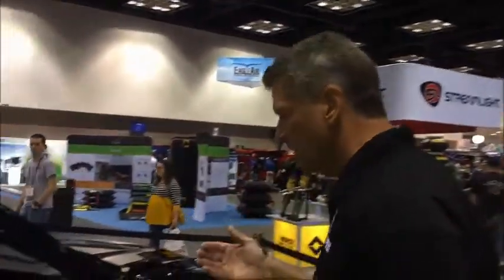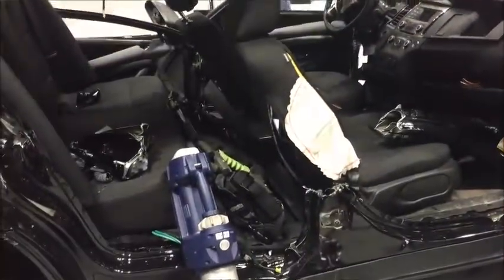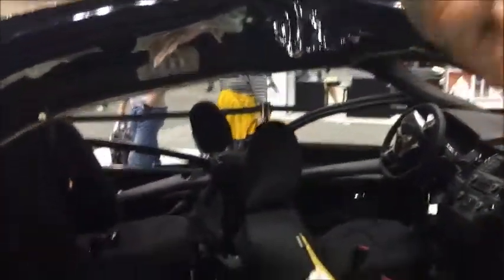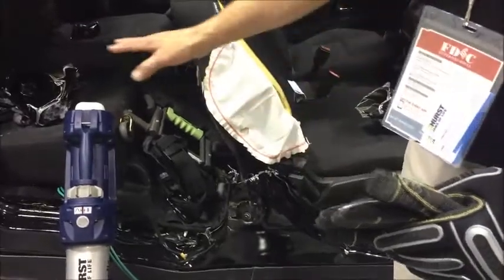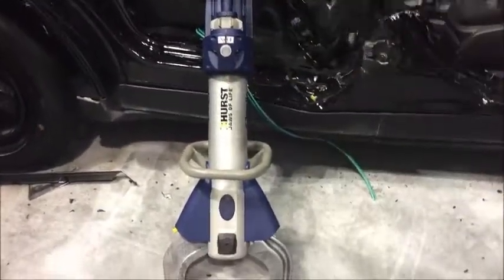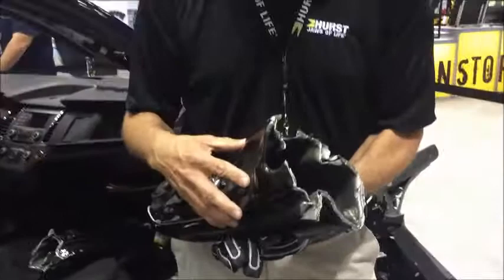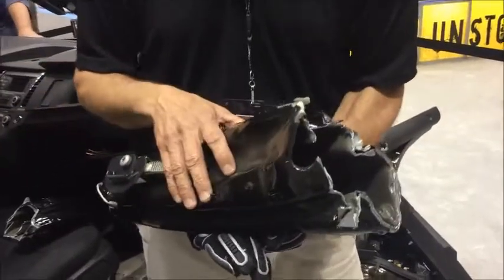For example, what you're looking at is a 2017 Ford Police Interceptor. What we have here is a high-strength steel B-post that was cut in one single cut with the new S799. As demonstrated by the removed piece, you'll notice older B-posts would be made of steels that would compress to a very small diameter. This allowed us to use cutters of a much smaller profile.